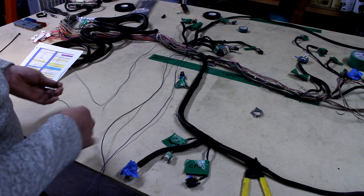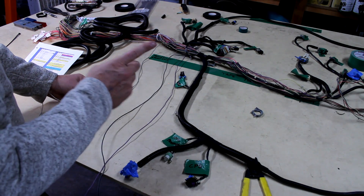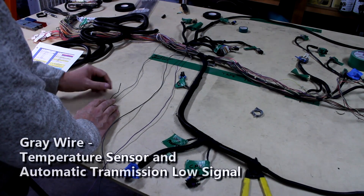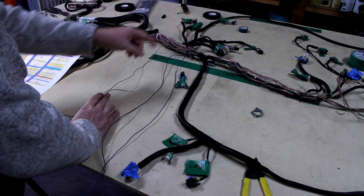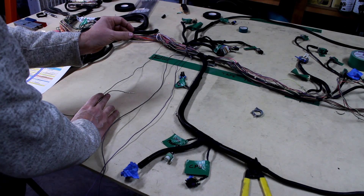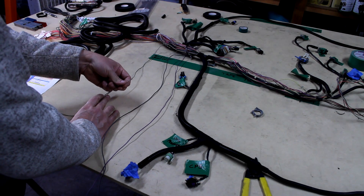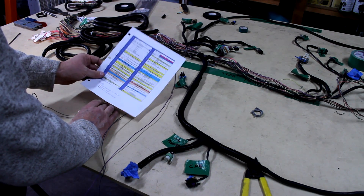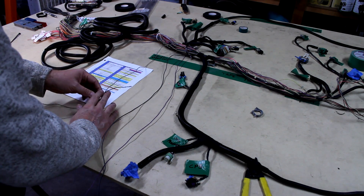This gray wire is a different story. I can tell because it's got one of these metal pins on it — this came from the PCM. So why did I take this off the PCM when its connector didn't disappear? If I follow it over, it goes to my temperature sensor. What I found is that there's a junction where this gray wire not only feeds the temperature sensor with a low signal, but also splits and goes down the transmission harness portion, providing a similar signal to the transmission. It must have been labeled as 'transmission' on one of these sheets, which is why I depinned it.